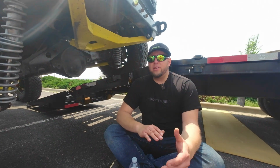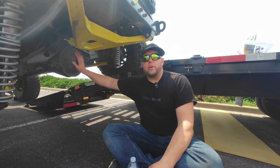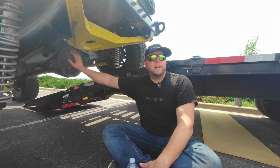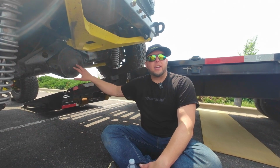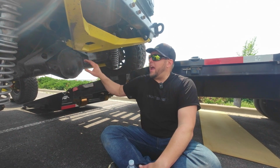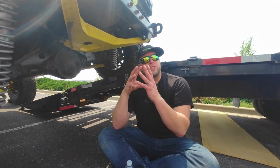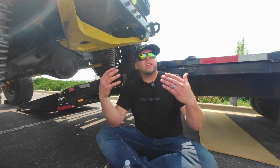And we do have a lot of people asking, okay, but I want a Dana 60 rear or a Sterling rear or whatever in the back with a big ring and pinion gear, really strong, and do 8-lugs. Well, we could do that too. You could reuse your stock axle in the back, an 8-lug Dana 60, whatever scenario. And in the front, we could do an 8-lug hub bearing unit and put that right onto the spindle. So you don't have different wheels front and back, but you get everything you want, right?